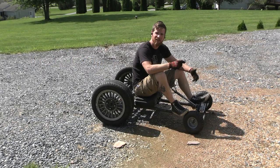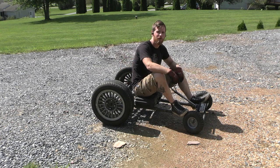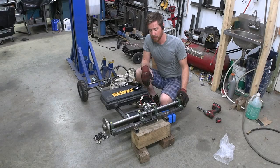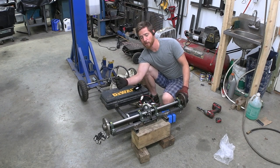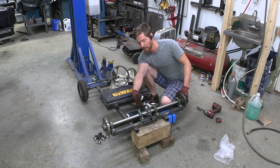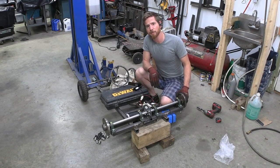It rolls and it turns, kind of. It doesn't turn very well because the rear axle is locked together, so you don't really get any slipping — I'm going to have to do something about that. It might also need some brakes. This rear axle being locked together means both sides of the hub always turn together, which makes it really tough to go around corners but gives better traction. To fix that, I'm going to separate the axles — they're already two separate pieces — and make it so the motor only spins one side. The other side will be able to spin independently.